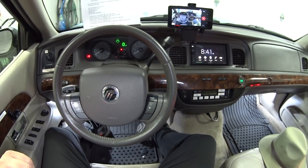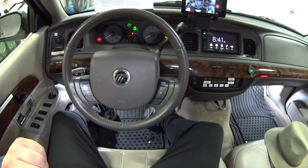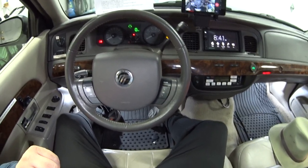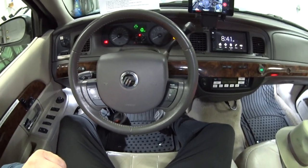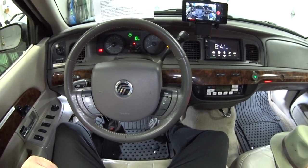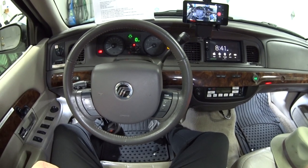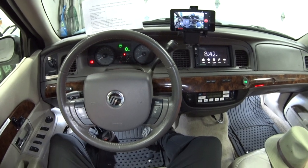Once the lamp goes off: one, two, three, four, five, six, seven, eight, nine. Now you can see that the airbag warning lamp is illuminated for three seconds, and then you do it one more time. The airbag warning lamp will then flash 12 times in three seconds to confirm the deactivation.